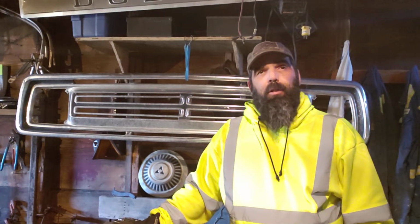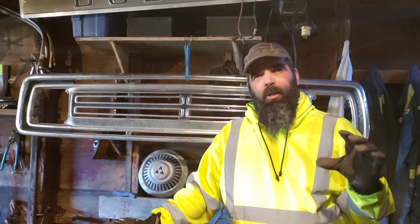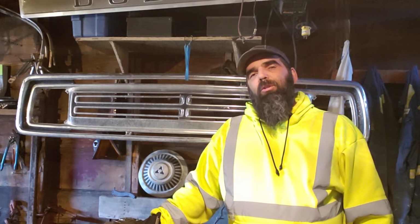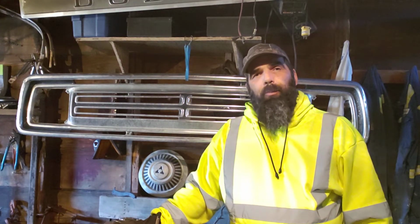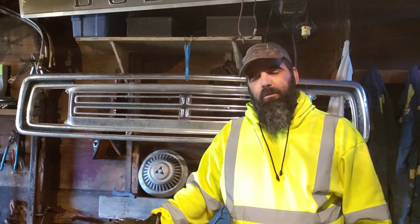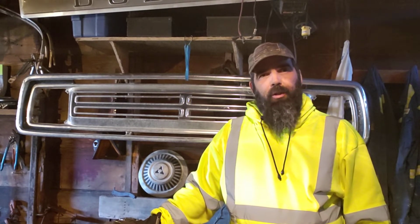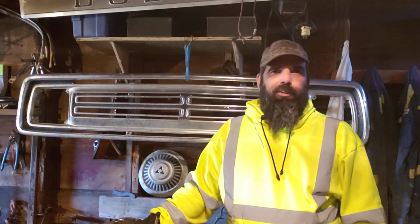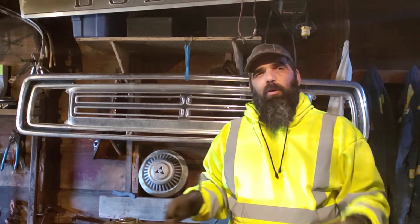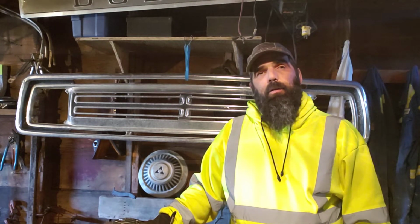In the front is a cut coil. Even with a van lower control arm, you get a fairly significant drop. But if you want to, say, just go a couple inches on a stock with a rear hanger and a front coil cut, we're just going to show you quickly how to get the numbers on that. Lots of guys just cut a coil and you're good. There's actually a little bit of math involved in how to figure out how much to cut.